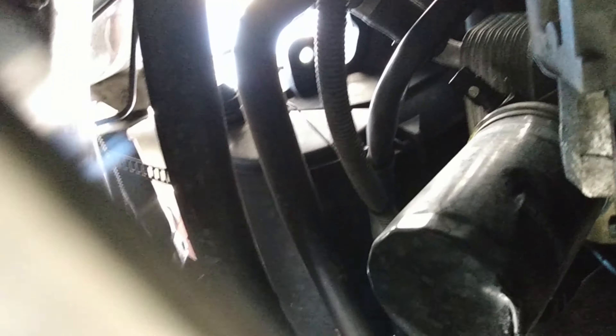I'm looking up now at the sensor — sorry, I'm trying to do this while underneath the car. There's the oil filter, and above that with the plug now off is the sensor pressure switch — I'm pointing right at it. I'm not quite sure exactly what size socket or spanner I'll need to get that off, but that'll be the next step. It shouldn't be leaking oil into the electrical part of the switch, so hopefully that's the problem.